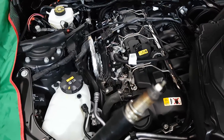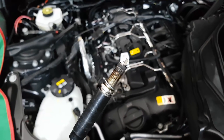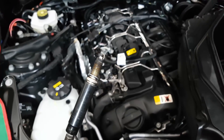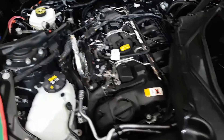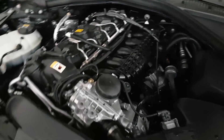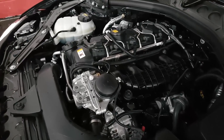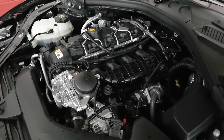Good color on it — there's no damage to the tips or the ceramic, so hopefully one grade cooler, as we do on most, should do the job. Spark plugs are in. Just on a base run on the dyno and it's taken out that little misfire that we had. Fuel pressure seems to be a bit more stable as well.